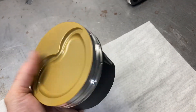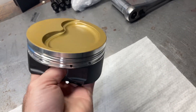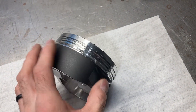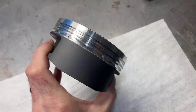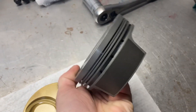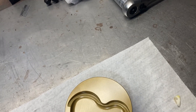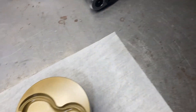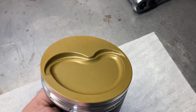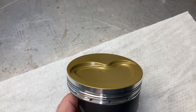This is a coated diamond piston — an FE piston for Mr. Holter — and it's been coated on the skirts and coated on the crown. The coating on the skirt is an anti-friction coating, and you see this a lot on pistons such as these Mahle pistons. They have the same thing, but this is to reduce friction in the cylinders. The coating on the crown is basically to reflect the heat of combustion off the crown of the piston and reflect it back into the combustion chamber.